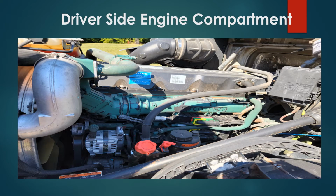You have your engine oil properly secured, no damages, cap is on tight. You have your alternator properly secured, no damages, and it is belt driven. Belt doesn't have more than 3/4 of an inch play. And there also isn't any leaks in any hoses.